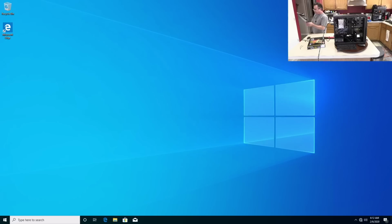Red Dead Redemption 2 was better in some ways and worse in others. There was lots of flickering initially, but restarting mostly fixed that. Performance at 1440p and 4K maximum quality improved by about 50%, but stutters and stability issues were more common. This is arguably the best case for multi-GPU now, and it still isn't great. Rather than trying to max out settings and resolution with SLI or Crossfire, I find it's best to just tweak some settings and run with a single fast GPU. You might not set any benchmark records, but you'll spend more time gaming and less time fiddling and arguing with hardware. But I admit, my SLI setup is an excellent space heater.